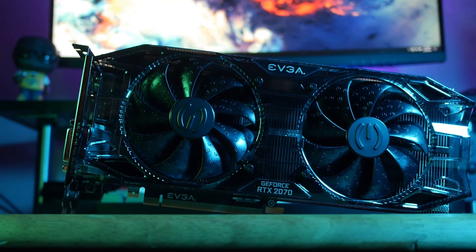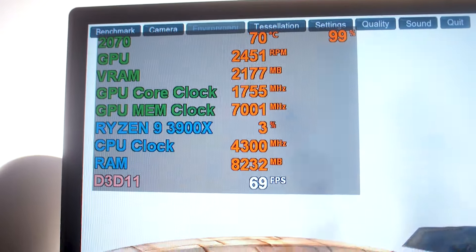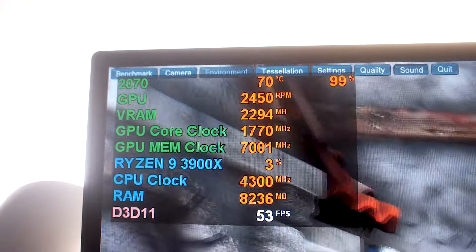Just to make sure, I did take it out and put in my RTX 2070, the non-Super. I just got back in the house from walking the dog. Let's check what the temperatures are on the RTX 2070 and see if they're still as high as they were with the 2080 Super. Now, it's been running about 30–40 minutes and it's at a steady 70 — the highest going to 71°C. Y'all can see what the issue is. The temps my 2080 was giving — sometimes sitting at 83–84 consistently and even hitting 85–86 — going up into that red really just had me uncomfortable.